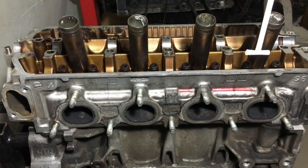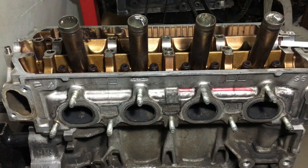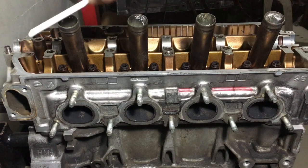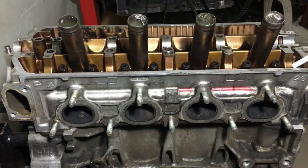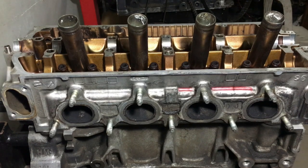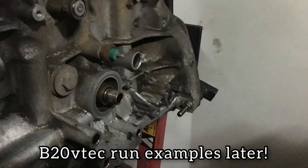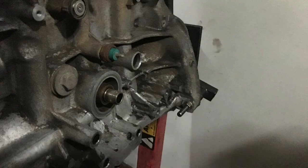This is why oil leaks from the cam seal, or the distributor O-ring, or even around the valve cover gasket are quite common, because the oil is just way above that level. And crankcase pressure tries to push up the blow-by, which makes oil drain a little bit more difficult. And this is the lone breather from the crankcase of the D-series SOHC. That is why it needs the most help it can get, especially on high compression or forced induction setups.